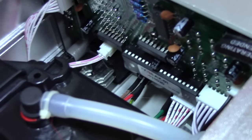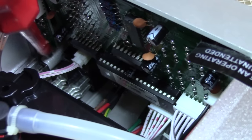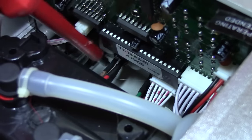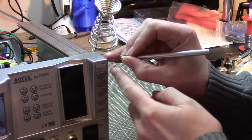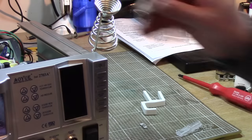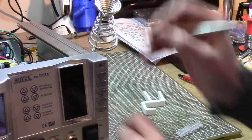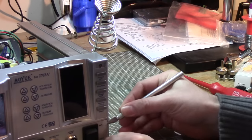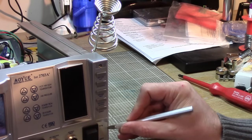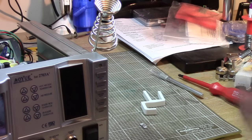It's half an hour later and I still haven't worked out how to get into this thing. My issue is these posts which come through from the front clearly have a screw going through from the front. The power switch has been hot-glued in along with all the other front panel connectors. OK, I've worked it out - this little logo is actually just a cover for that screw hole. Over here, if we get the corner of this sticker, we've got a screw hole we can get at. And the same in the corner under the power switch. So I'm going to whip those three - maybe four - screws out and see what happens.